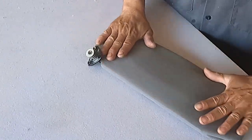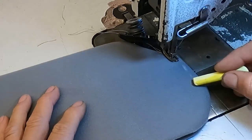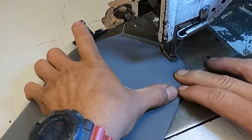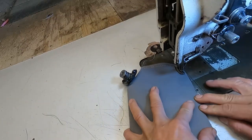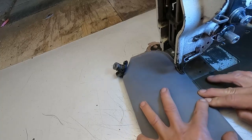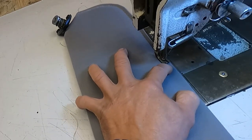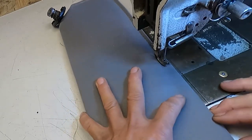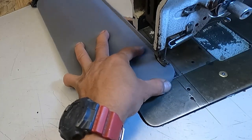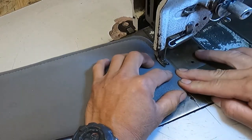Then I apply glue on the chipboard and on the base of the sun visor. I recommend you to apply glue in there. I glue it and make sure the edges look even, because if it doesn't look even when you sew it, it will be uneven — and believe me, as an upholsterer, you don't want that. Draw a line one quarter of an inch and sew over that line. If you have been doing this trade for a long time you know drawing a line is not always necessary, but if you are just starting, I recommend it. Because this material is thick, I recommend you to use an upholstery sewing machine — don't try with a regular cloth sewing machine, those are not going to work for this.